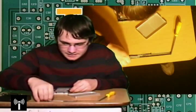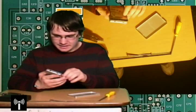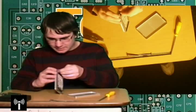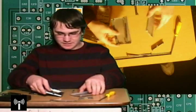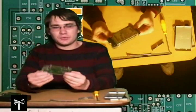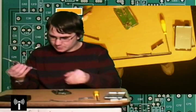The first step is you're going to want to get a screwdriver, and there'll be four screws along the sides. You want to take those out — this one's already been pre-removed to quicken the procedure. Once you remove those, it's basically just a simple procedure of pulling the casing apart like that. This is all stuff we're not going to need to worry about, and you're left with a SATA hard drive on a special circuit board. In order for this to be actually usable, you're going to need to get rid of the circuit board — pop it off so it can go into your laptop — and that's another very simple procedure.